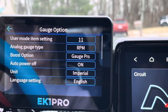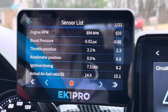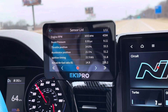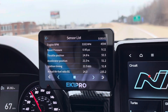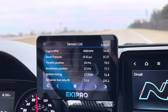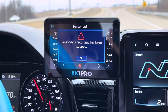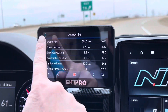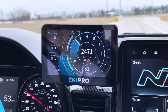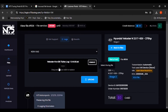After you've selected the requested gauges, click OK. This will save the gauges in the User Custom View section. Take the car to a safe, open road. Put the car in third or fourth gear and hit the gas hard in that gear all the way to redline. On the EK-1, click on Gauge, then User Custom View. This will take you to the data logging screen with the gauges you selected earlier. Hit the red data log button on the bottom of the screen to begin logging before you start accelerating. You can do a couple of pulls to ensure you got a good run logged. Once you're finished logging, click on the square at the bottom of the screen. The EK-1 will automatically create a file for the log. Once you have your data logged files, go back to the computer. Transfer the files from the logs folder on the EK-1 SD card to the file uploader on the tuning portal. You can drag and drop the files into the portal. Once the files have been loaded, click on the upload button to send the files to N75.